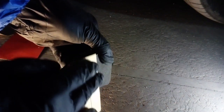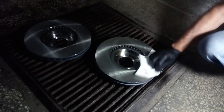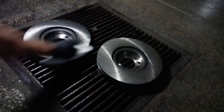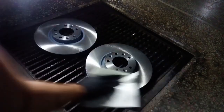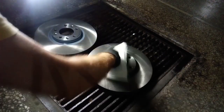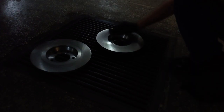Don't forget to rub the beveled sides also if there are any. The rotors are another story as they need to be cleaned from the oil that is applied from the factory. They are usually cast iron and they rust easily, so they have a thin layer of oil from the factory to protect them during transport and storage, therefore they need a thorough cleaning both on the braking surface and the hub. I use and recommend carburetor cleaner as it cleans any metal surface from any oil or grime, but any brake cleaner will do the job.